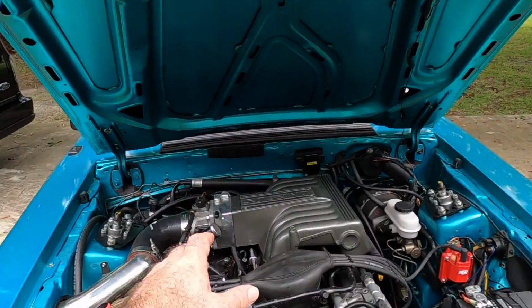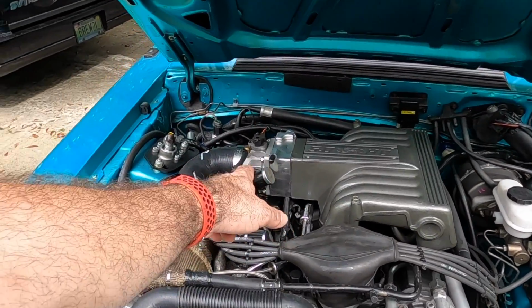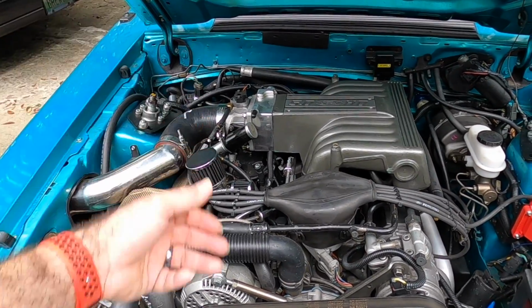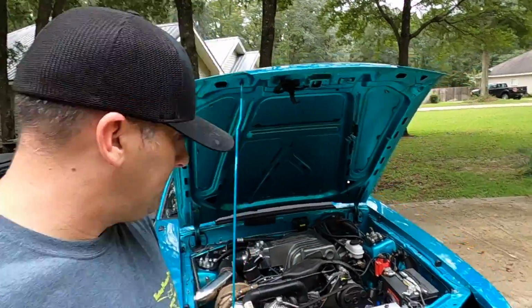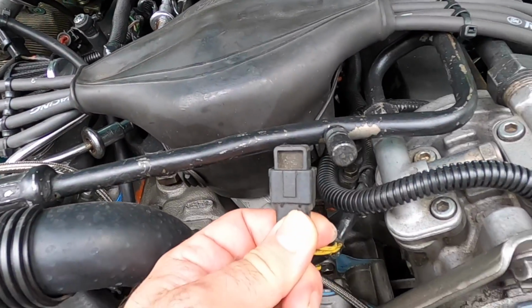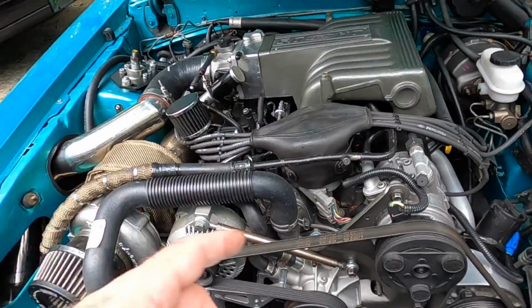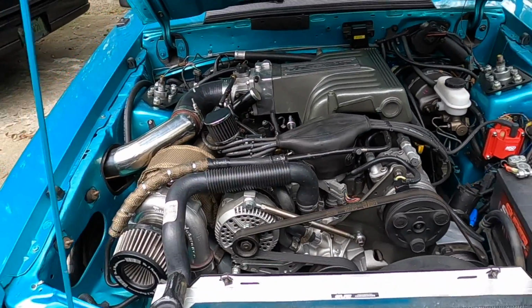Once everything is good with your timing, your idle air control, your TPS, you can go ahead and start hooking everything back up and do your base idle reset. In the description, I will put a link to the base idle reset video. Now, in that video, I did not mention when to put the spout back in. This is your spout connector right here. In the video, I did not mention when to put that in. As soon as you get your initial timing set, go ahead and pop that spout plug back in and you're good.